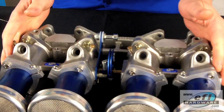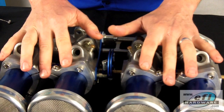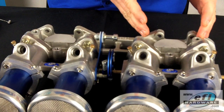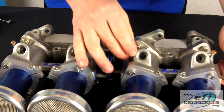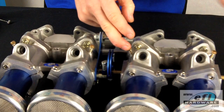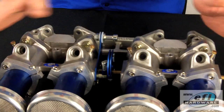Now we have our throttles fitted, the linkage mechanism working beautifully, and it's all balanced. However, on some engines we have to see different levels of vacuum between one cylinder and another. This can be an issue when you've got one shaft with two butterflies and you're getting a difference in vacuum reading — that's where the idle speed screws come into action. With small adjustments and a synchrometer you can get the idle perfect.